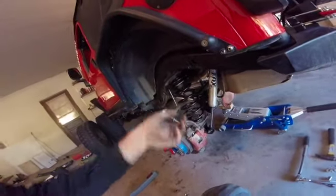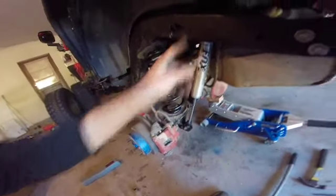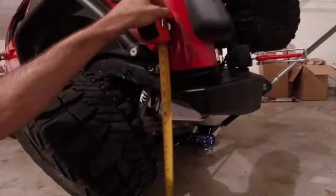But yeah. So once I got all the control arms in, I put in these springs and then the shocks. The shock lower mount gets tightened to 74 and the top gets 24 foot-pounds. They reused the original bolts. Absolutely blowing my mind right now.